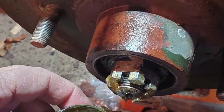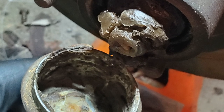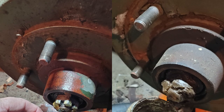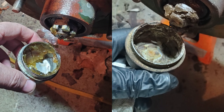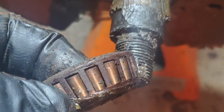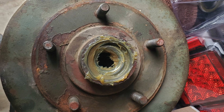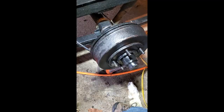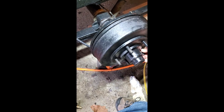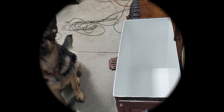We start part two by digging into the mechanical parts. The first thing with any trailer you want to look at is the wheel bearings — it's simple, it's easy, it's inexpensive, it's cheap insurance. One of the bearings was bad in this trailer; got the new bearings put in today, not a sound, perfect.